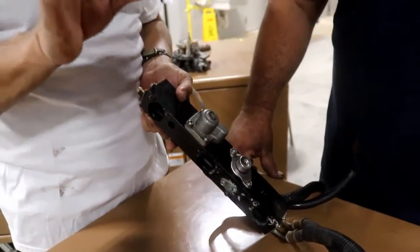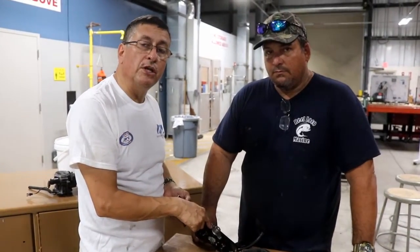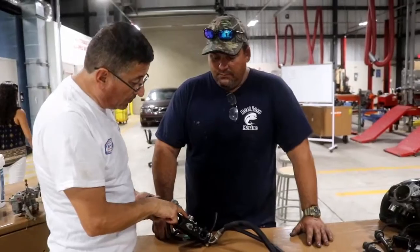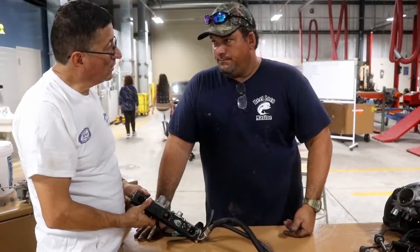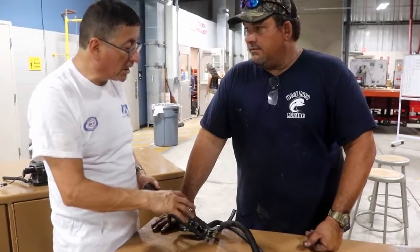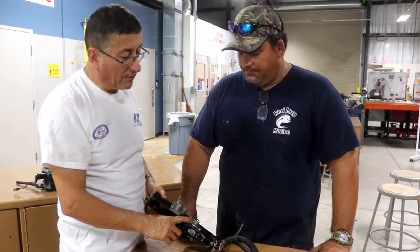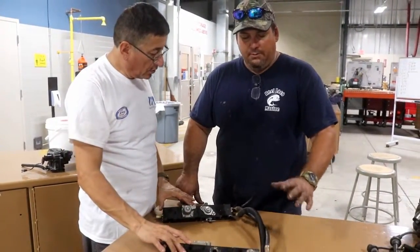Okay, because if you remember, guys, in diesel the pressure regulator is adjustable. You can increase or decrease the fuel pressure in order to get better fuel pressure into the injection pump. Here, it's not adjustable. No, it's not adjustable. But what is the symptom when the pressure regulator is damaged, Danny? Well, a couple things could happen. You might not have enough pressure, or you might have too much pressure. Too much pressure is possible too? Absolutely. In that case, the solution is to replace it. Now, there is a screen in there that you can actually take out and clean. If you see some debris in the screen, you can clean it out and retest the system. Okay, perfect. All right, this is Optimax. Two-stroke Mercury Optimax.